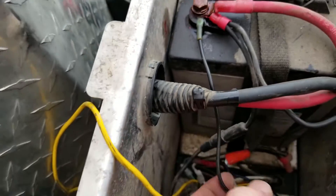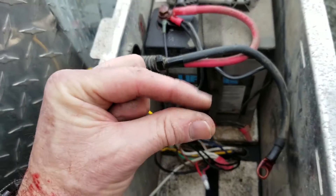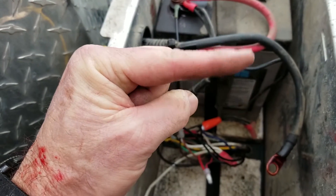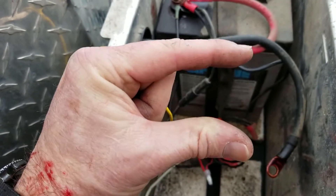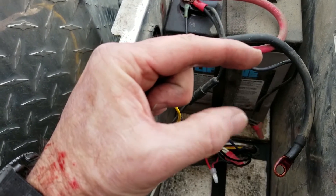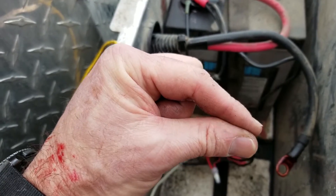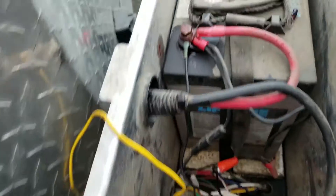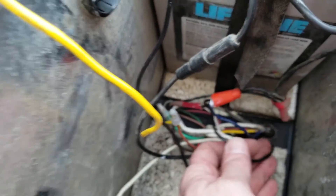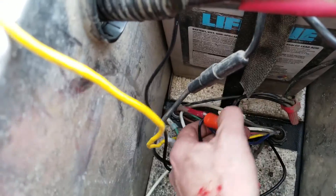This black wire is connected to my battery positive — right there, connected to battery plus. So one side of the contacts: the pin in the breakaway switch is holding these contacts apart. When I pull it out, they slam closed. The black wire that has 12 volts on it makes contact with the other wire, and now I'm feeding 12 volts back on that second wire — which ties into my brake circuit.